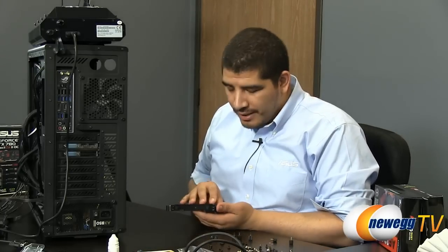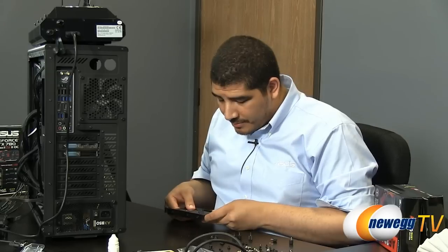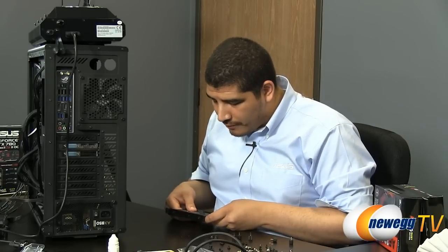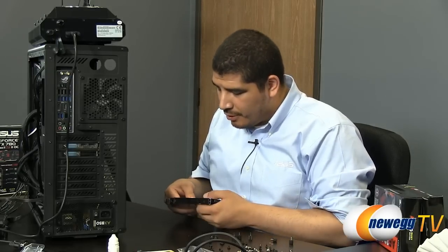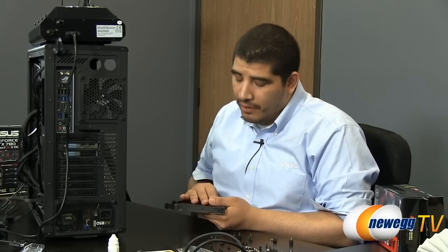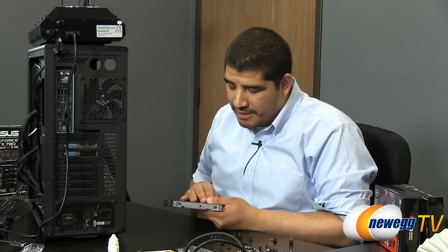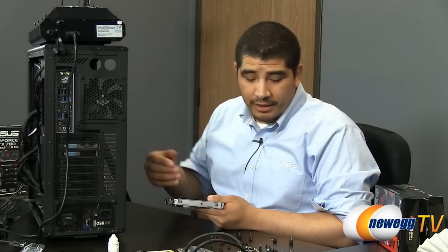Interesting enough. But it can also vary to other items like per header fan control, offering customized fan curve options. If we go back to the original ROG Commando board, we had a board that had full, what were referred to as capless based designs, which was using POS caps in the CPU socket, which we don't use historically right now.